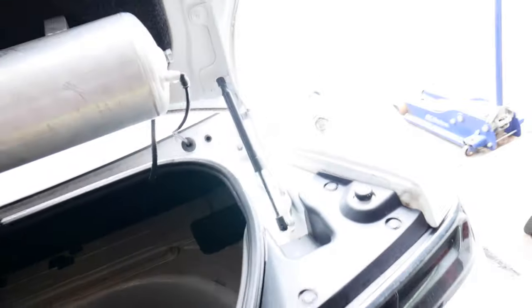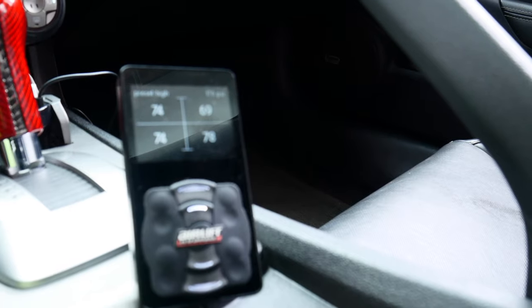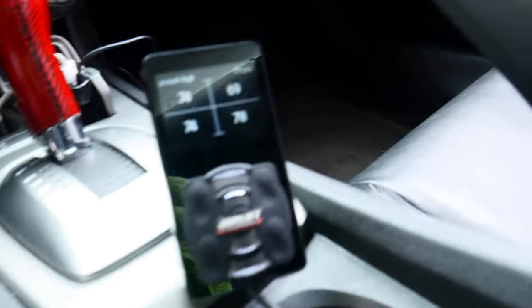Make sure that this taillight is good, we'll go ahead and tighten everything back up. As you guys can see the car is running and we're trying to see if it's gonna leak. Oh yeah, it's definitely still leaking. I went ahead and tightened everything down — literally all of the fittings, the ones connected to the compressors, airline, and all of the ones that connect to the tank. I tightened down every single one and re-teflon taped every single one. Hopefully that fixes the issue.